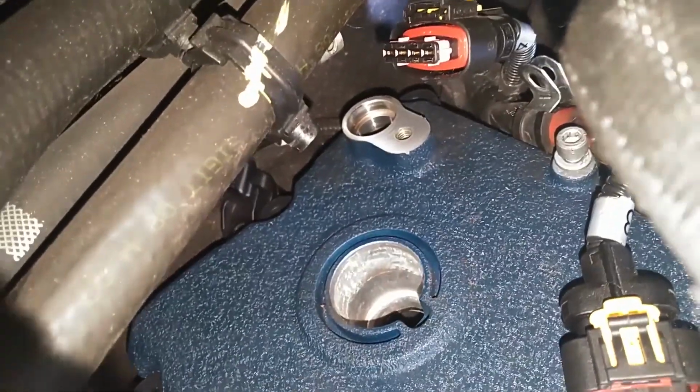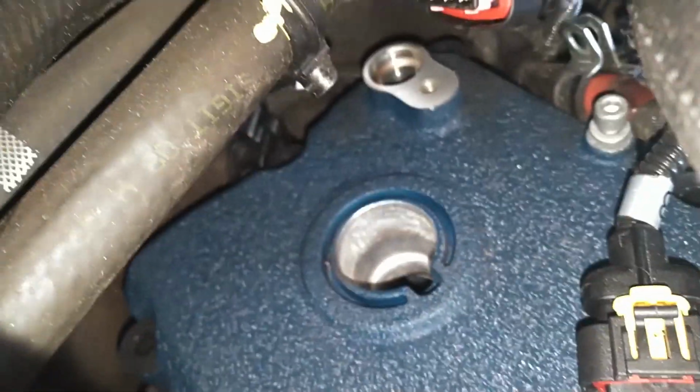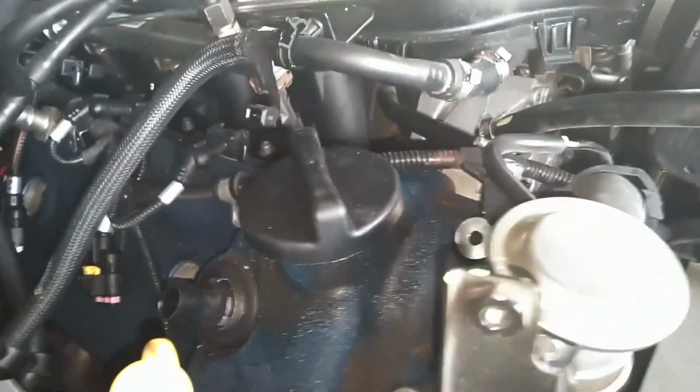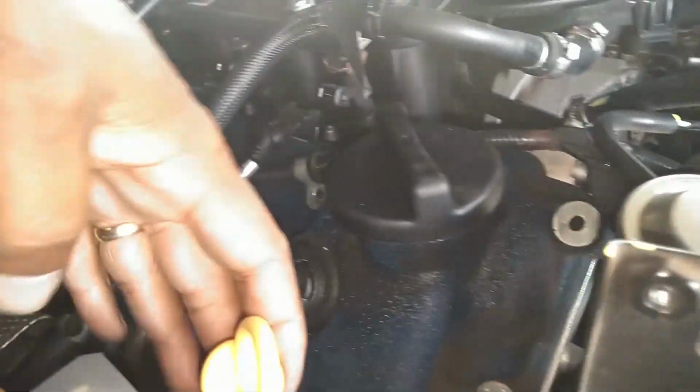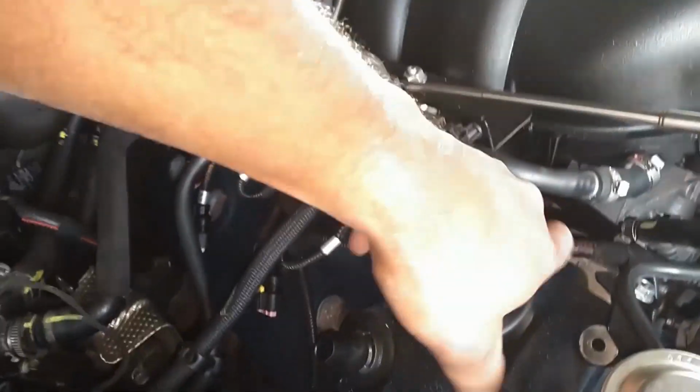And I also had to pull out that cam sensor. The cam sensor is hooked up on the wire harness. You can see it laying back there. So I unplugged the fuel injectors. Everything should be loose. I hope to have enough room to get this cam cover off. I didn't see the bolt securing this oil dipstick, so I'm gonna leave that there. And let's see if I can get this cover to come up off of here.